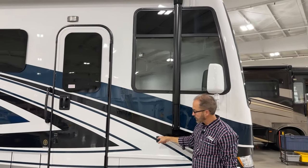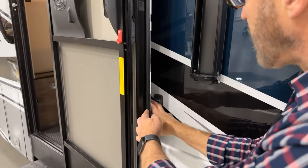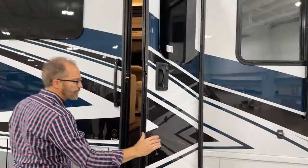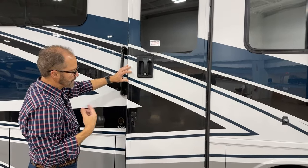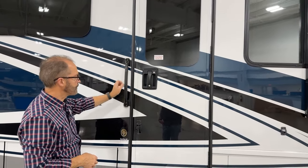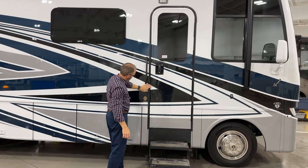You can also use the door lock. If you open the door, this small plastic handle is inserted at the top here — after you insert that, push down to lock, so now the door is locked in the open position so the wind won't catch it. This door, when you close it, has two separate latches — one that initially catches and then one that closes it completely. If someone's inside taking a nap, close it soft — that's the first latch, the soft close, just to be quiet; it still seals but doesn't slam. When you're ready to travel, you're going to have to close it all the way into the second latch, firmly. Now you're in the second latch and the door is even with the trim.